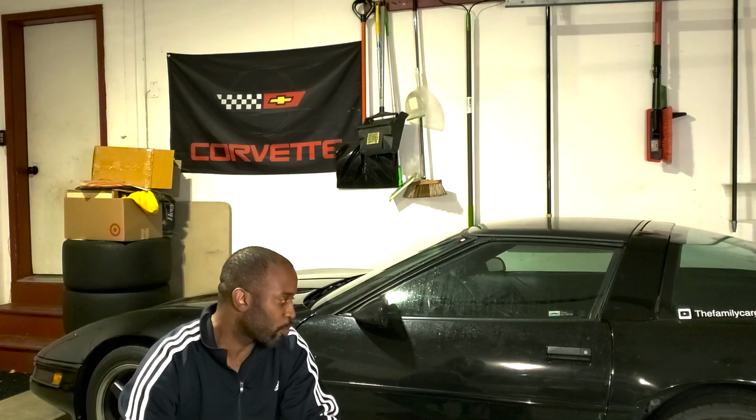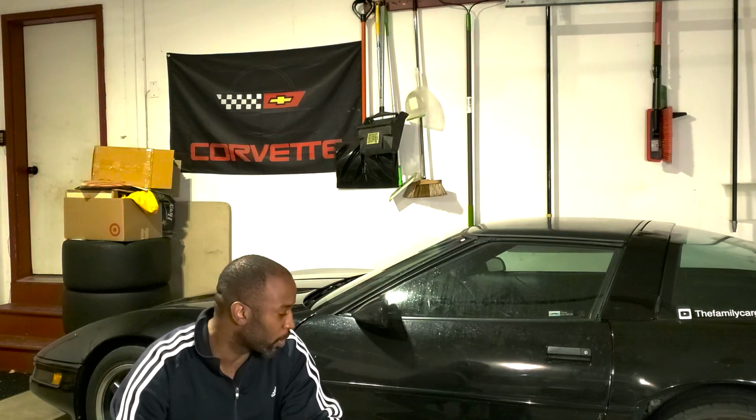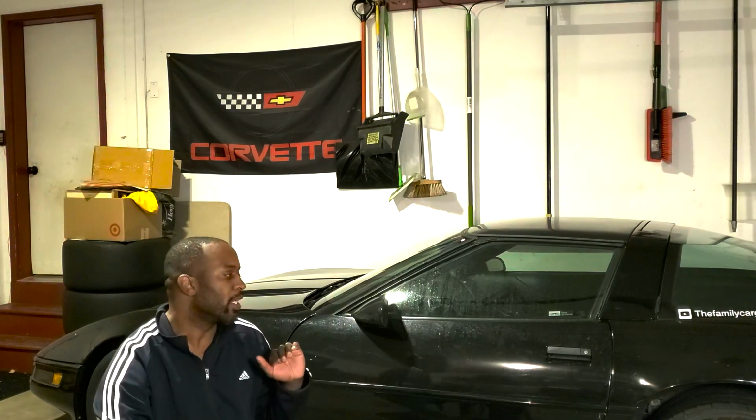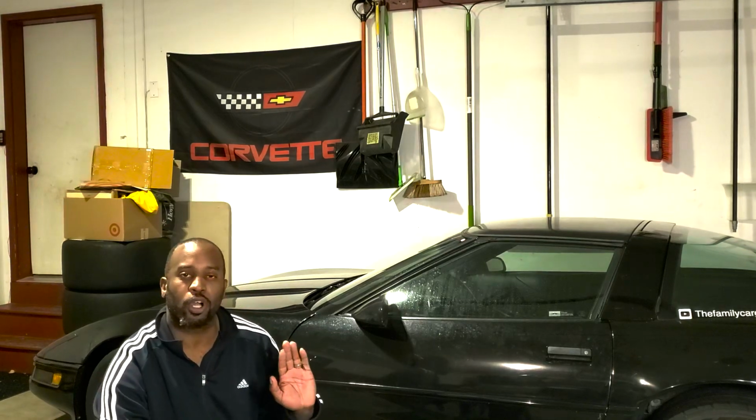Oh, also I have the brake bias spring, which is very difficult to put in. I actually did not put it in; I had my local shop put it in. It pushes more of the braking to the back. So the car still brakes primarily with the front brakes, but you get a little more rear brake in there, and that helps the car on hard braking.